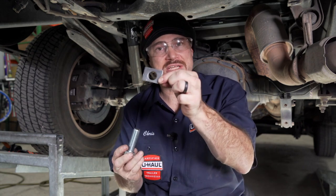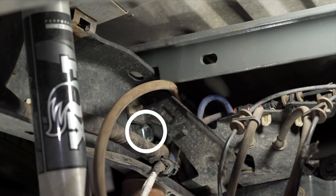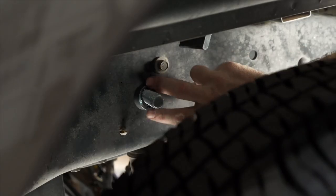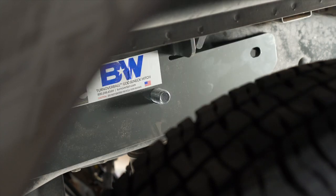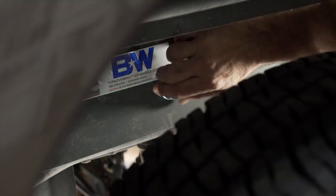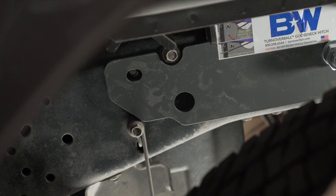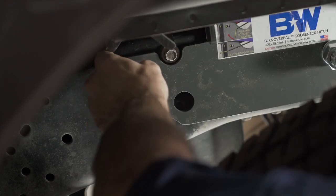Now that we have our cross members in place, we're ready to begin installing side plates. We need to get this custom washer and get this 3/4-inch bolt through the elongated hole. Place one of these spacers over the 3/4-inch bolt before you attach the side plate. Make sure you use the side plate that has directions for the handle on the driver's side. Now place a lock washer and then a nut. Now install the half-inch hardware with a flat washer, a locking washer, and a nut.